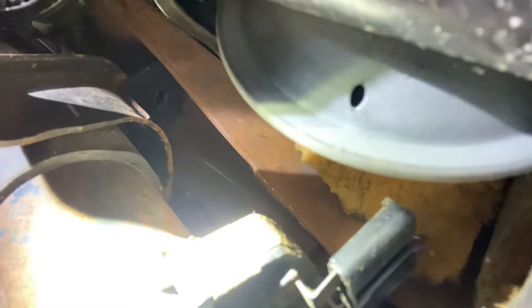But we'll flip this around down here. Oh man, this is a pain to see. A real pain. Anyways, that plug that you're looking at is where we need to jump. So we're going to grab a little jumper here, strip that out, and then hopefully have our issue solved. Well, not solved, because then we'll have to get a new switch, but closer.